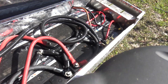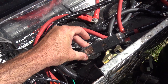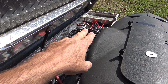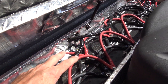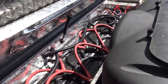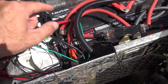You see solid copper connectors over here like this — those connectors are like $12 for a 10-pack. I got the fuse here for now on the main feed, 200-amp fuse. And then I have the other two batteries over there, which are basically 120 amp hours, 12-volt, the same kind for the 12-volt system. So the 24-volt system goes to my inverter, and the 12-volt over there is for the lights, the fart fan, the outdoor lights and stuff like that. My 60-amp charge controller. I just wanted to make sure I was finished before I get these alligator clips off, run the wires, and seal it up.